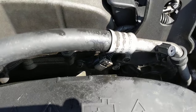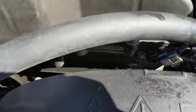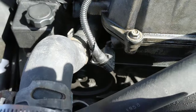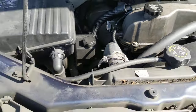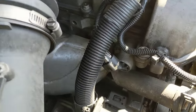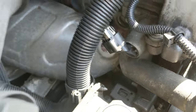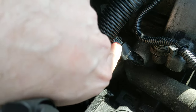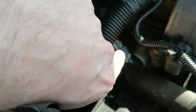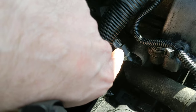Obviously I don't want it to die on the side of the road. Now the position of the sensors — it looks a little wet down there as I just sprayed some engine cleaner. I believe this is the intake sensor and I believe this is the exhaust sensor over here on the passenger side. Also over here is a related sensor — this is an exhaust solenoid. I've read that this piece has screens inside; the screens can fall out into the oil pan which will trigger I believe a P0014 or P0017 error code, but that's not the codes I'm getting so I don't think this piece is at fault.